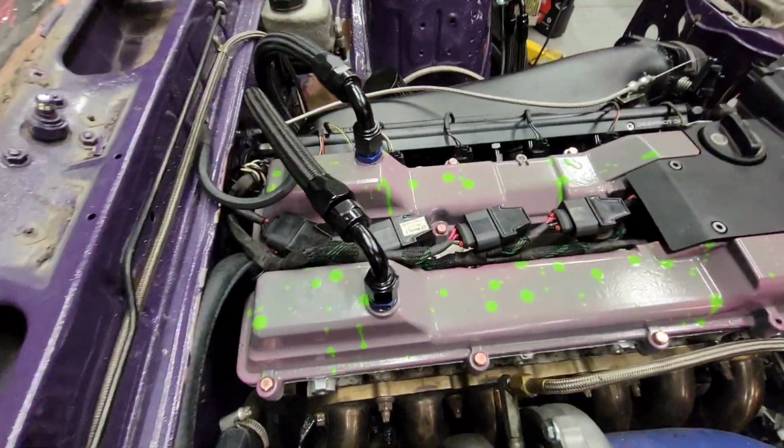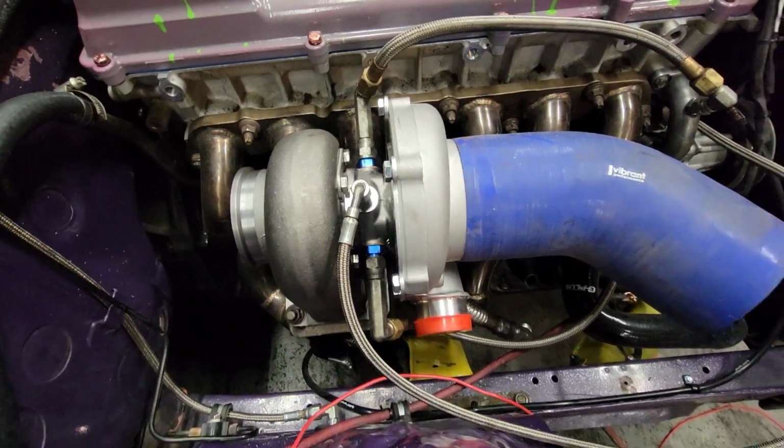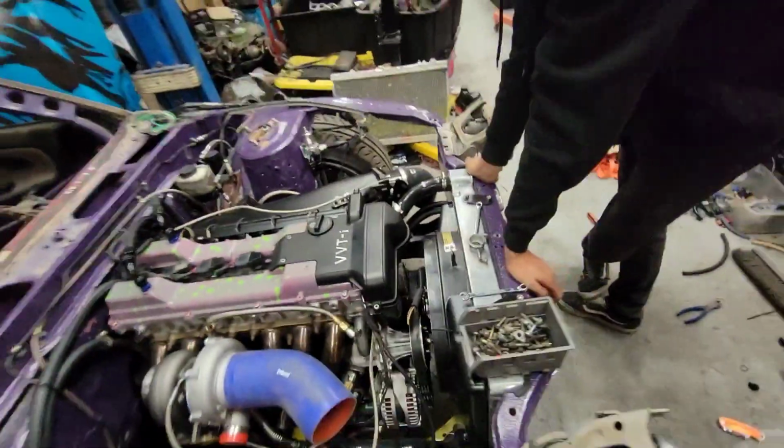We got the coils, okay, and Brian got the turbo mounted and the fittings all installed. The turbo drain. This is a new one for old B. I don't even talk about what kind of drains I do. If you know, you know. And this one is actually looking a lot better. Not perfect, but it's better. So all we gotta do is run a little jog -10 from there to there, and then the drain's done, the feed's done, all the other oil lines are buttoned up.